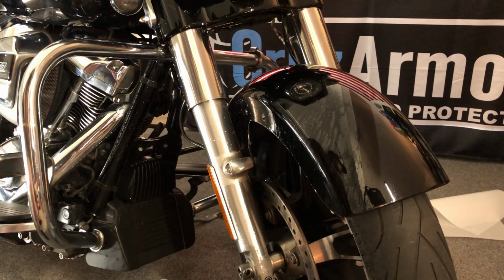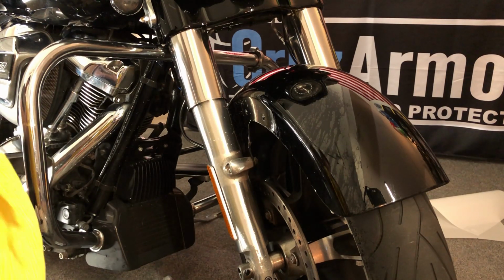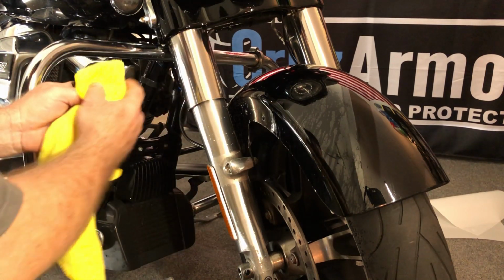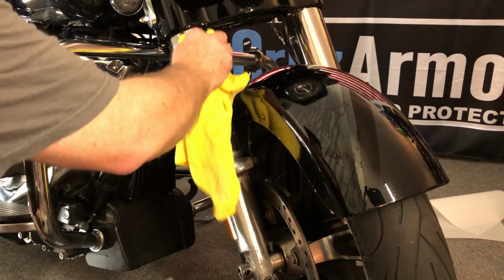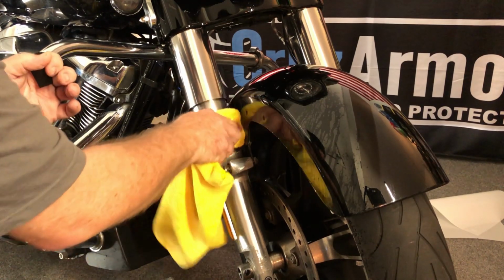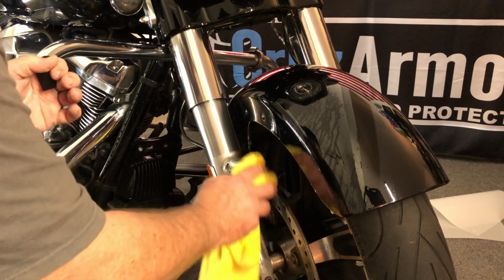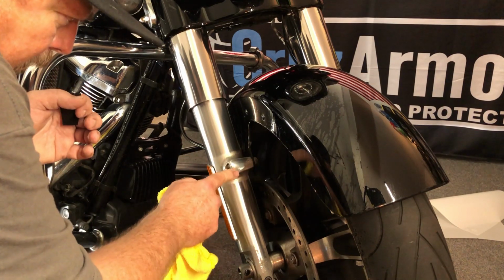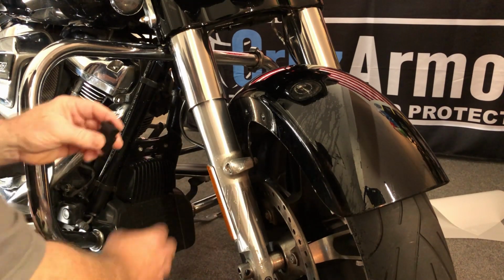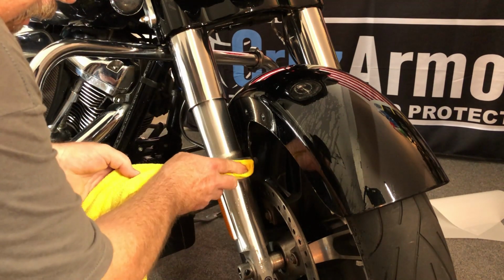And that is it. Now you want to grab a dry towel and just wipe. And you want to wipe it in the direction you were squeegeeing, so you don't wipe up against an edge where you might peel the edge up. So start in center and work your way out to the edges. Same on here. And then on here, that little nub. And again, there's a little finger that's lifting right there. So you can take some alcohol and just lay that down. And again, you can use a dry towel to almost act like your squeegee.